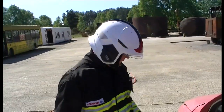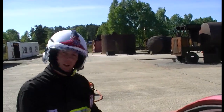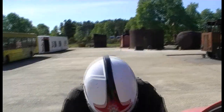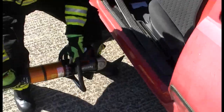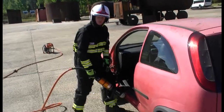Okay, on that last cut, we did get a little bit of movement in towards the vehicle, but it was nicely controlled. All we did was reposition the tool round and carry out the cut with loads of space, no more issues with ingress into the vehicle. What's also good is, if we're cutting the seals, whereas before we'd be down here, difficult on your back, a lot of strain working low like this, I can now be in quite an upright position to operate the tool because of the 30 degree offset angle.